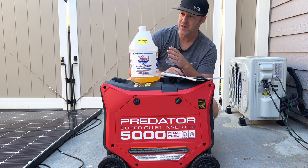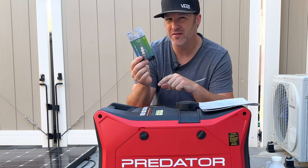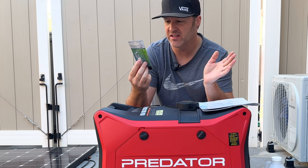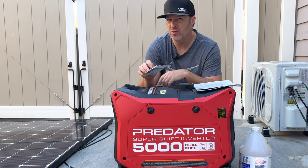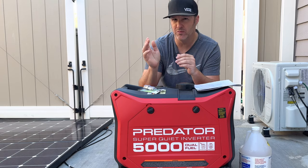The last tip is when you go to change out your spark plug: almost all of these new units will come with a torch spark plug. I have found that I haven't had very good luck with these — they foul out sooner, they don't last as long, and they don't start as well. When you go to swap these out, you can still use the one that's in here until it dies if you want, but go with an NGK spark plug. NGKs just still work better. Don't get anything fancy — no iridium tips, no split fires, nothing weird like that. Just go with a standard NGK spark plug. I'll leave a cross reference for the one down below in the description so you can buy a couple plugs and have those readily available for when it's time to change it.